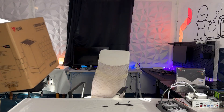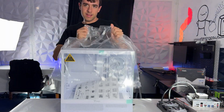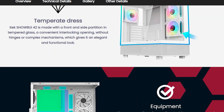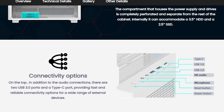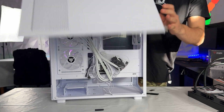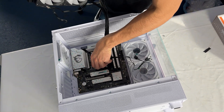Case airflow contributes too, so let's talk about the case. It's the Showbui 42W, and I think it's a bestseller here in Italy — I've seen it in so many budget builds. There's a reason for it: it comes in at $100, it comes with three ARGB fans pre-installed with an integrated controller, also a controller on the back with a standard 3-pin you can connect to the motherboard. The fans have infinity mirrors on the side and a reverse blade on the side — pretty cool for a budget case. The white version is very well made: fully white even on the I/O on top, all filters are white, and they even painted all the I/O cables white, including USB 3.0 and USB-C.